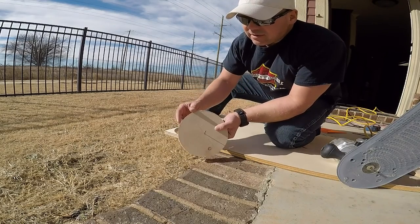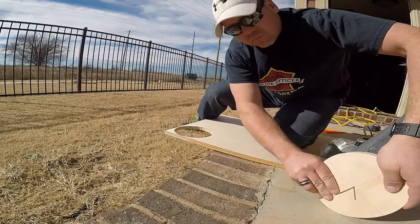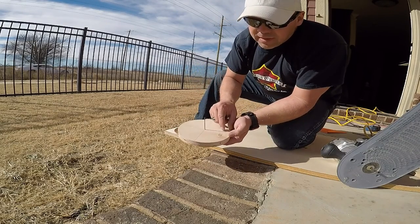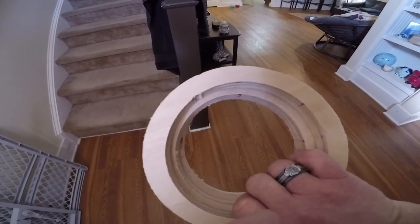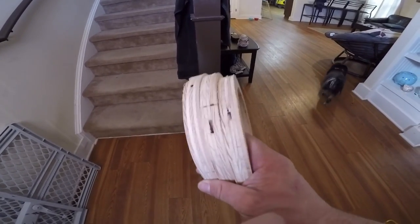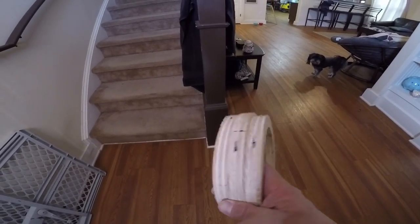Just like that you get the outer ring — you'll have to take a sander, sand it down, or a lot of times work on smoothing it off. Then I want to measure, come into the inside, and make the rest of the ring so I can drop the speaker down. I've got all of the rings cut out. I left the very top one a little bit thinner because it gives the speaker a little bit more air space. I'll glue them all together, fill in all the holes with some wood filler, sand it down smooth, and then paint it with an epoxy paint so hopefully it'll match inside.